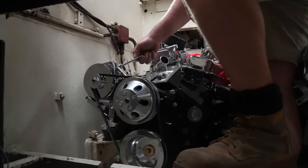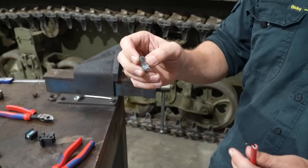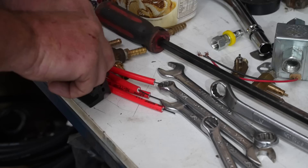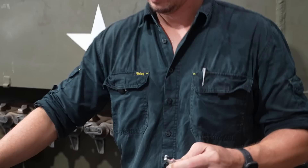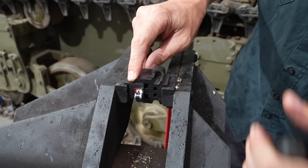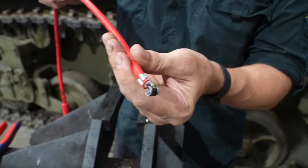In order for petrol engines to work, they need a spark. The distributor, which we watched Ryan calibrate earlier, delivers electricity through these red lines into the spark plugs in the engine. This is the terminal end for the spark plug — the ignition leads. We've just trimmed them down and we're re-crimping new ends on so we don't have leads like spaghetti going everywhere. We can fold the wire over, crimp the end on, put the covers back on, and then they should be about the right length.